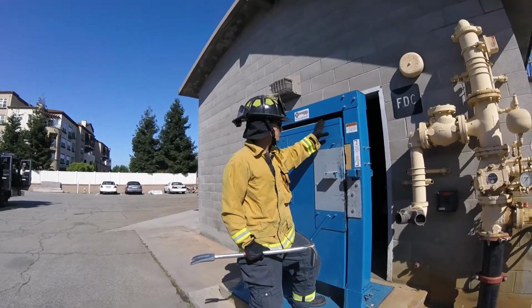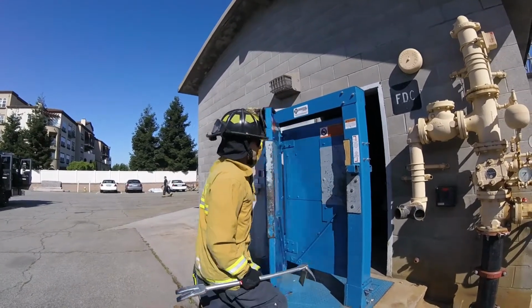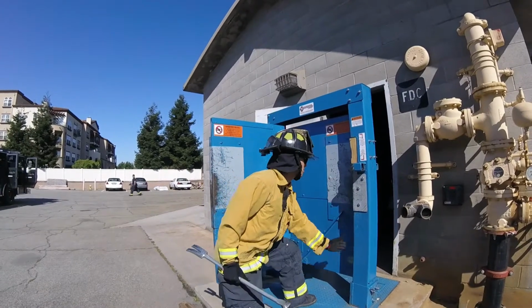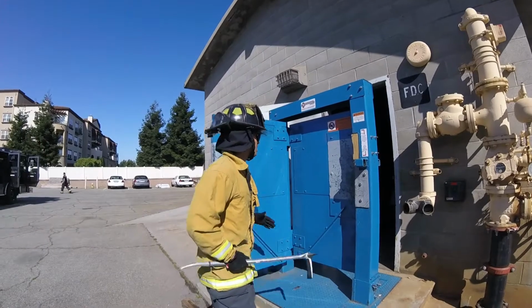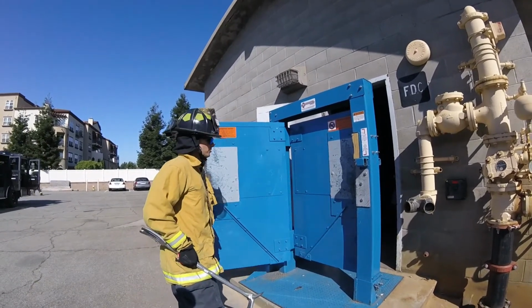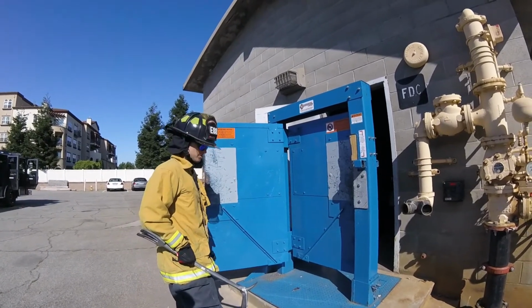I've seen a lot of people shocking these doors, but you're not going to feel anything because you have this jamb and it's going all the way around the door. So every time you sound it, every time you shock it, you're going to feel resistance in the same amount. So it's not going to tell you where any of the locking mechanisms are.